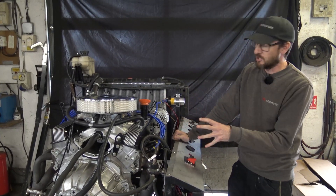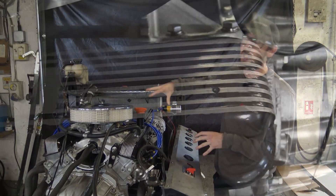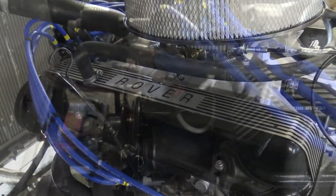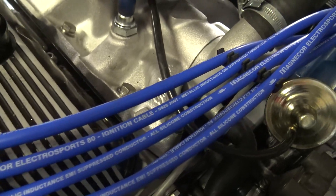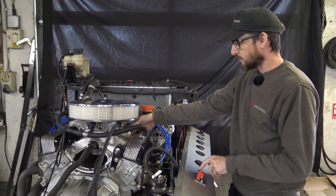So we've got this engine on the testbed. Specifications of the engine are: 4.6 bottom end, Stage 3 cylinder heads, Piper 270 camshaft, full RPI ignition kit, and Edelbrock carburettor. We've built the engine up as a full turnkey engine. The customer is in America — he wants to extract his engine and put this one in, doesn't want to change any of the covers over. So that's great for us — it means we can run the engine up on the test cell, get the ignition timing set, do the base settings on the carburettor, which we've already jetted for a 4.6. So we'll just fire it up.